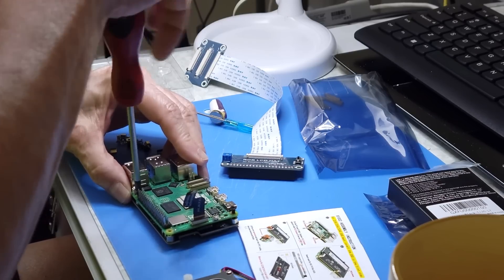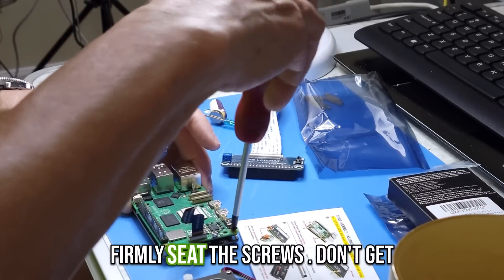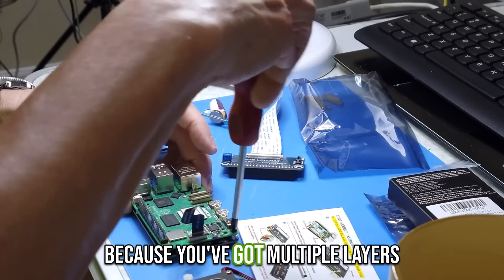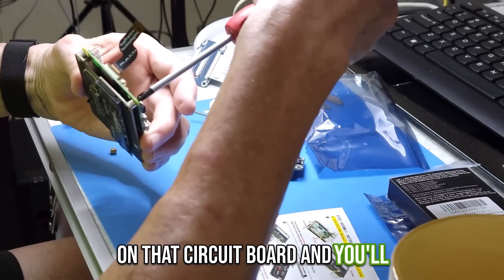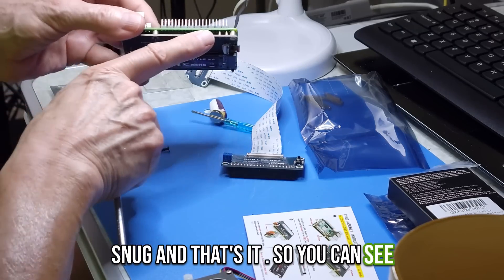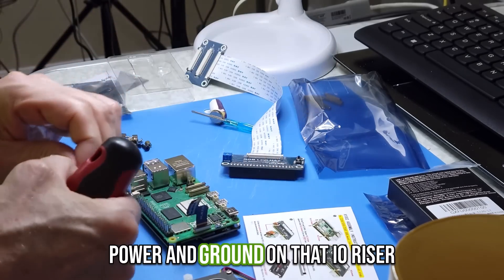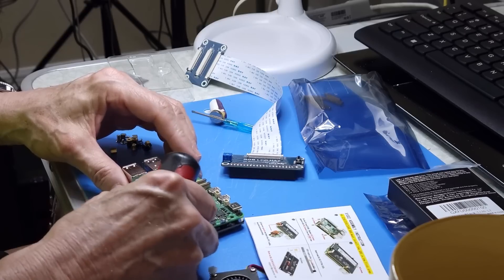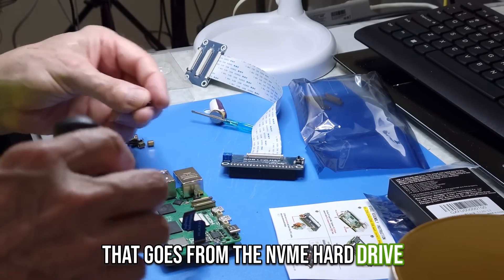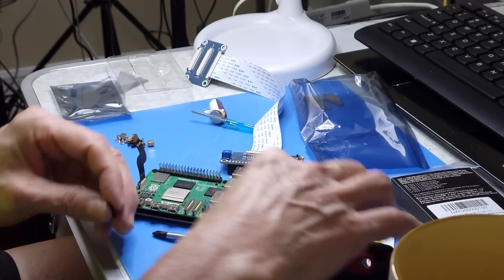You can see I'm tightening those up. As always, when dealing with printed circuit boards, just firmly seat the screws — don't torque them down too hard, because you have multiple layers on that circuit board and you'll crush the board. Just snug, and that's it. You can see the golden fingers that come up from the NVMe board and touch power and ground on the IO riser.